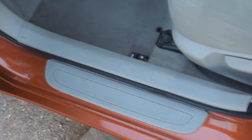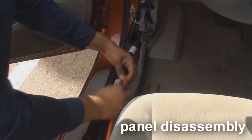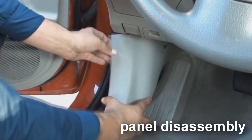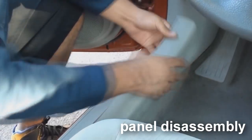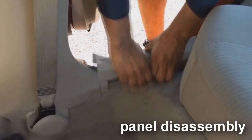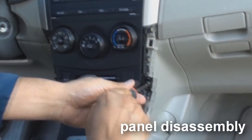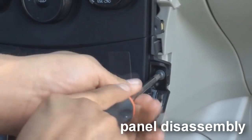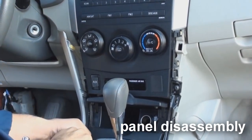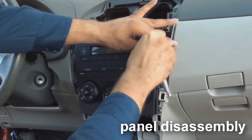Let's start off by disassembling the area for our signal and power cables to be ran. Since we will be running wires down both sides of the vehicle, let's remove both side kick panels, door scuff plates, lower trim panel, upper trim panel, and if needed, the seat belt cover anchor. Once that is complete, disassemble the dash. If you are unfamiliar with how to disassemble a dash, watch my video on how to do so in the how to install a car stereo install tutorial.